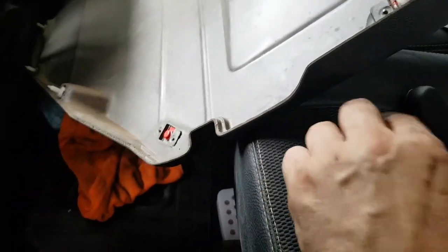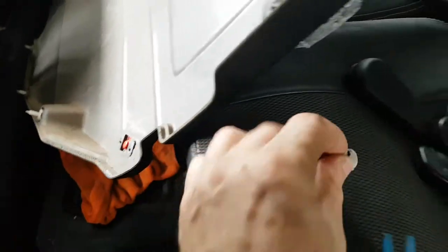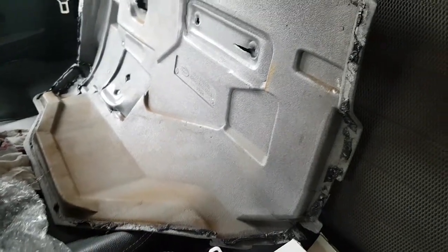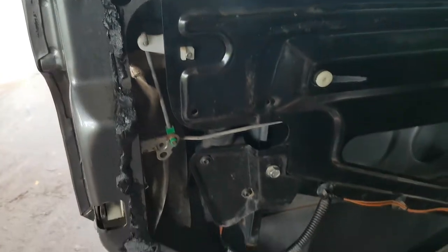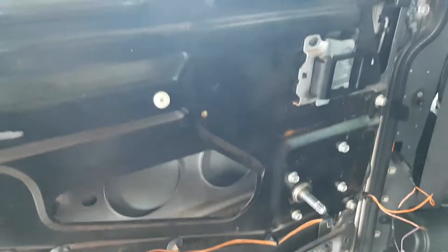The clips are more on the top than the bottom. You can see one of them has come off here, which is not unusual, and then you can put it back on — they pop back on. Underneath that is this inner cover which is stuck on with all this black sticky stuff, and then you slowly peel that back without tearing it and you've got to the internals of your door.